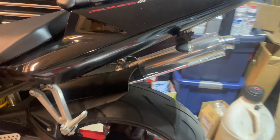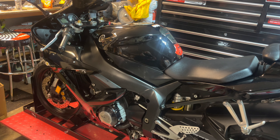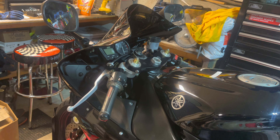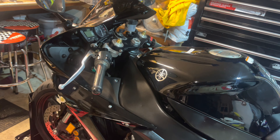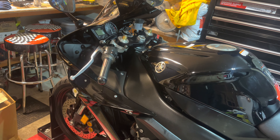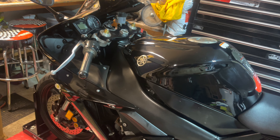It's a little dirty because I was riding when we had some salt on the roads, but overall it's not too dirty. Another thing we did was lube up the OEM clutch cable and man, what a difference that makes. You've got to make sure you lube your cables on these bikes — it makes a big difference for sure. And if it doesn't when you did it correctly, it just means your cable was in good shape to begin with, but you'll be surprised how much it does help.